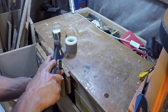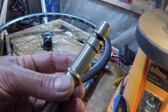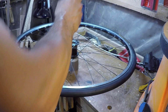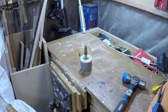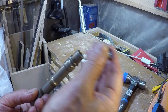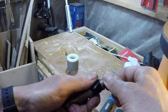To use the axle to remove the non-drive side bearing you'll first need to remove the magnet, held on with some electrical tape. Mark the side of the magnet facing out with a black marker so you tape it back on the correct way. To remove the non-drive side bearing, place the wheel the other way around on the support and slide the axle back in and tap it with just enough force to remove the bearing. The bearing should slide off the axle — if not, remove it as shown for the drive side bearing. Tape the magnet back on with some decent electrical tape and give it a good few turns.